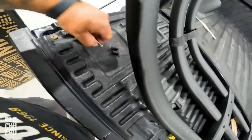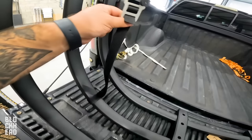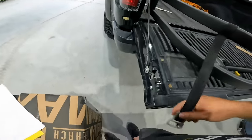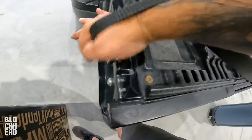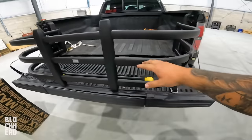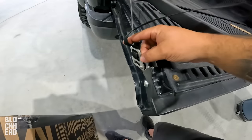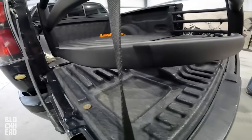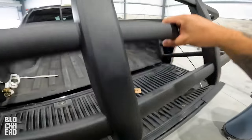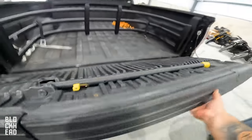You should have a couple of extra pieces of hardware — these are for putting into the latch of the tailgate. It already has some on it. Whenever you've got the extender mounted, you can bring these over, clip them into the latches, and tighten as necessary. That's just an extra thing to secure the extender down so when you're driving it won't bounce up and down crazy on bumps. To get it out, pull the tailgate latch and that pops right out. If you want to put the tailgate up, throw the extender forward and put the tailgate up — good clearance, that's awesome.